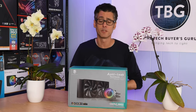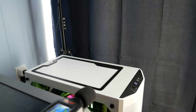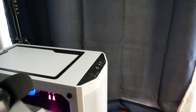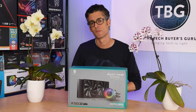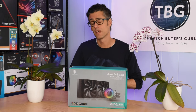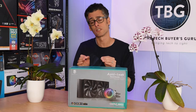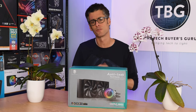I did think about doing decibel-normalized testing as I do with my fan tests, but I couldn't do it here because the source of noise — the radiator and its fans — was moving inside the chassis. So if I had a fixed microphone placement, it might favor the front or the top position. There was no way to make that normalized because the noise source isn't normalized. Third, I fixed the fan RPMs in my case and on my GPU. My case fans were fixed at 700 RPM, and my GPU fans ran at 0 RPM when not under load and 60% when under load. I wanted all those fixed so they didn't change in response to changing temperatures and therefore skew the results.